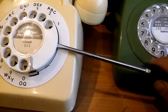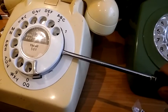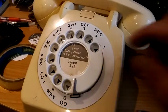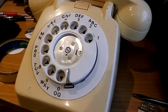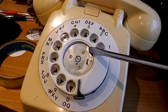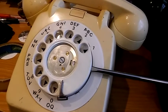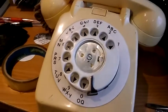Now I don't know if I can do it while I'm holding the camera but I'll give it a go. You just basically have to get this in there and give it a twist — there you go, popped off and fell on the floor, but that is how you get the cover off. Then you can just take out your paper label and replace it or whatever you want to do. You can see that underneath there is a metal piece, and this metal plate is actually spring-loaded on this edge, so when I put the screwdriver in and twist it you can see it move — this spring-loaded plate is what pops off the centre label cover, and that's basically how you do it.